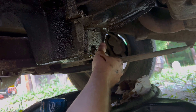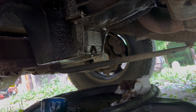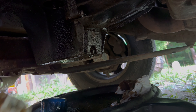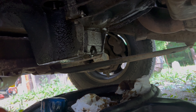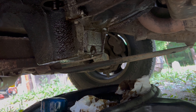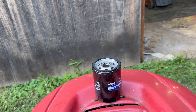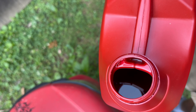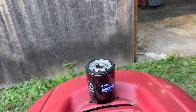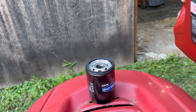You just want to tighten the drain plug up real good. Now this is important — a lot of people just slap an oil filter back on, but that ain't what you want to do with these engines or any engine. You want to prime this thing. Also, this filter container was supposed to be sealed but the lid didn't have the sealer on it — probably went cheap. Either way, here's what I'm talking about with priming the oil filter.